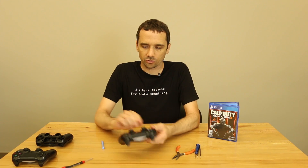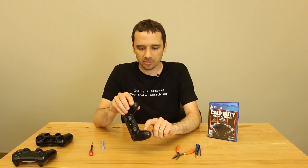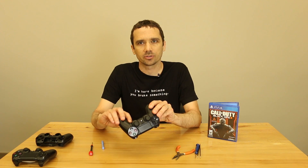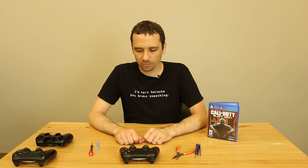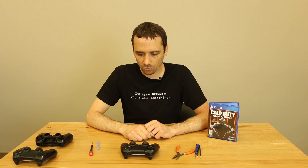After those screws are in, you're going to want to make sure there are no big gaps on the sides. If there are — sometimes there is right here — then you've got to take it apart, as there may be some plastic clips that are bent and you'll want to bend them back. But that shows you how to take it apart and get it back together without breaking anything — you can see there's nothing broken on this controller; it's all in great shape. I'm going to link up some other videos we're going to be doing — we're going to be replacing the analog thumbsticks in the next video, I'll link it below. We'll also be doing a battery replacement and a few other things, so take a look at our other videos if you need help with your PS4 controller. Thanks for watching.